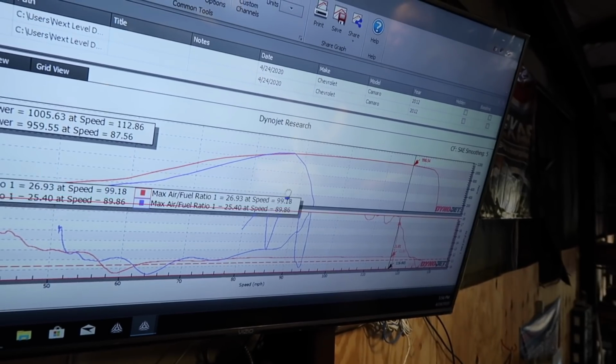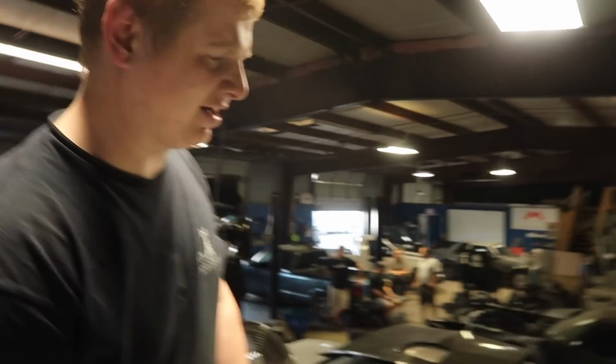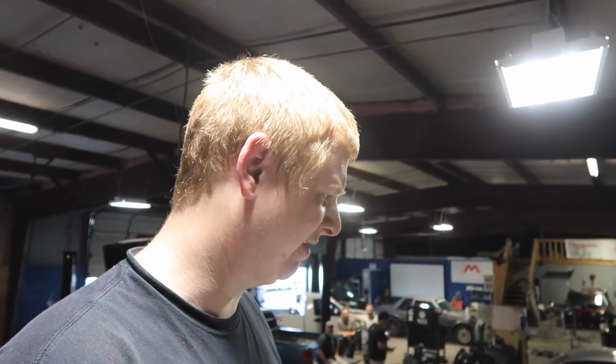So, here's my thing. Is it trying to turn that third pump on? And the pump's not. I mean, for the power you're really talking about, two would probably get you there. But what would cause it to go that way? Clogged fuel filter or... So we gotta look at something mechanically in the fuel system.